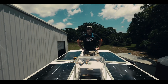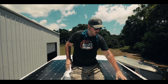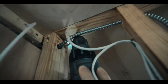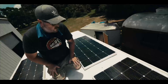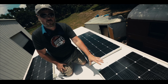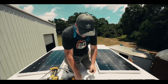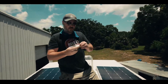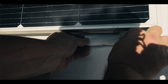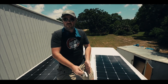The first thing we're going to do is have Julie drill a pilot hole from down below to run our wiring through. We got our pilot hole. Next I'm going to go ahead and mount the solar panels in place — the same way I did it on my last bus, which worked great. I'm going to use some butyl tape and run it on the underside of the bracket the full length, so it acts as a buffer and seals up any opening that would be there from the screws.